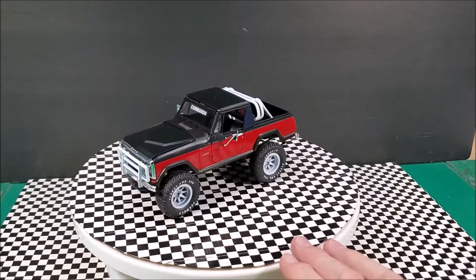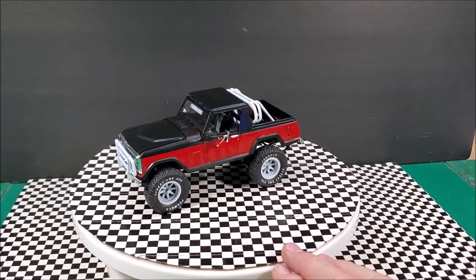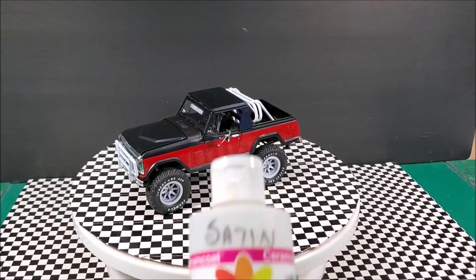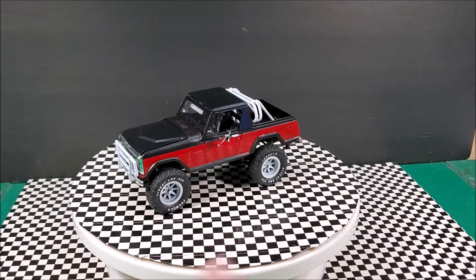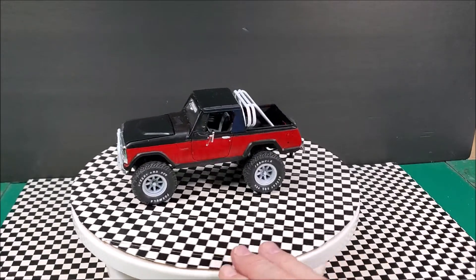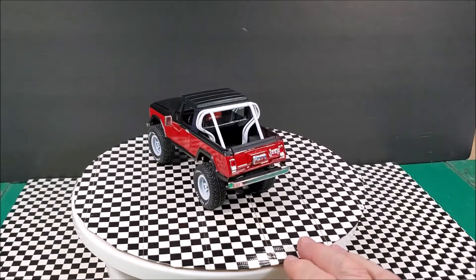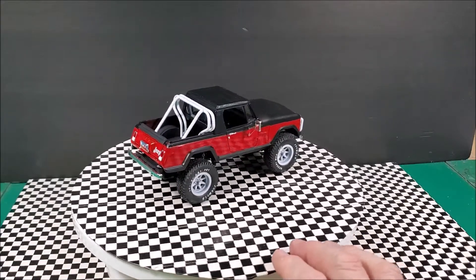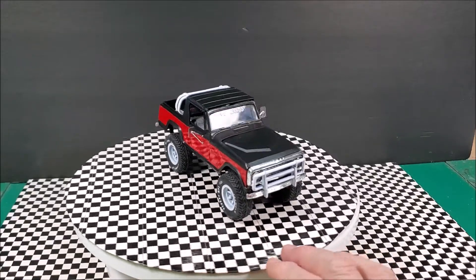I black-washed the grill. The black paint is nothing but Rust-Oleum black primer, and I used Delta Ceram Coat satin brushed over it to give it just a little bit of a sheen. It is not as shiny as the red paint. The red — you can see on the tailgate — is pretty shiny. It came out with a little bit of an orange peel to it, but I'm okay with it. I don't do perfect paint jobs.